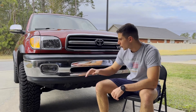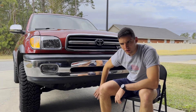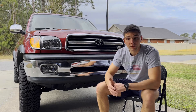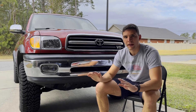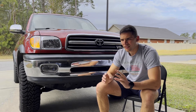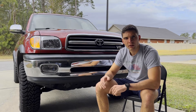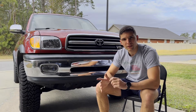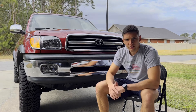Hey, thanks for checking out my channel. Today we work on my 2002 Toyota Tundra. In order to do an oil change on these trucks, you have to drop the skid plate that covers the bottom of the engine. It's been dropped a bunch of times and the bolts that hold it up are just mangled. There are five bolts: three grabbed really well, one is iffy, and the last one doesn't grab at all.